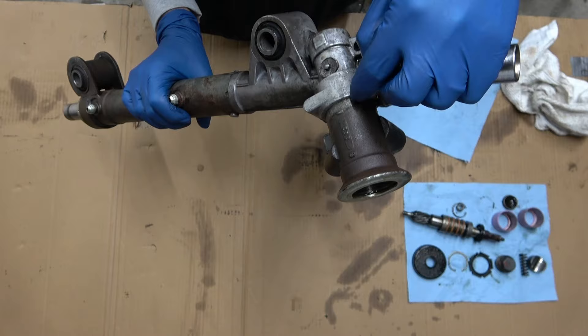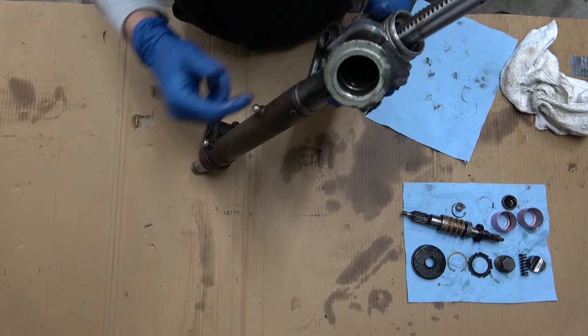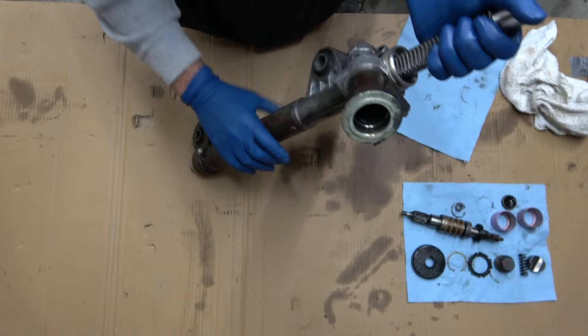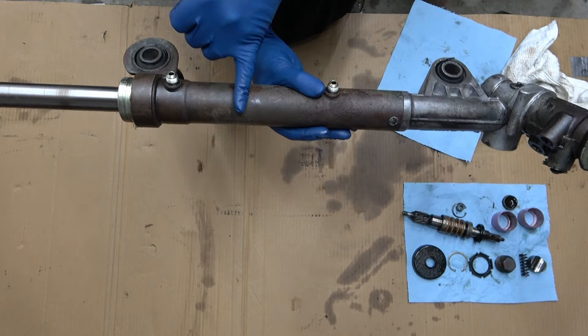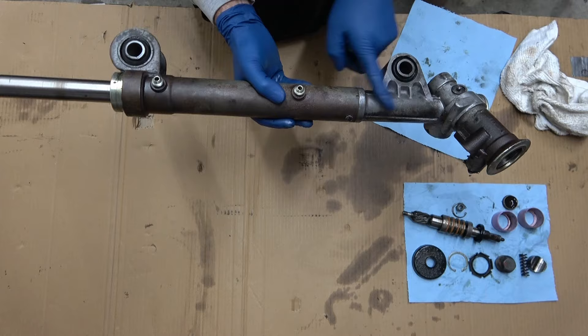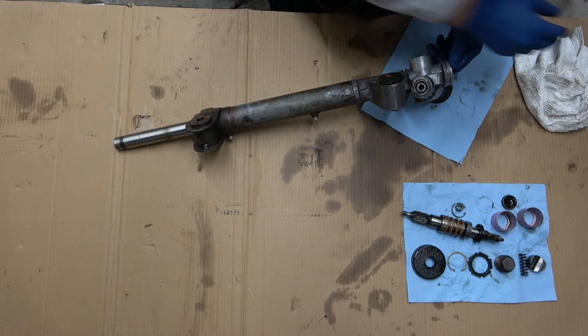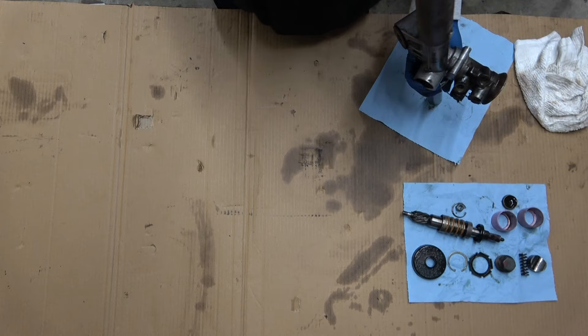With that out of the way — you're not going to be able to see it in the camera — but deep down inside here, right where the two parts of the housing meet, there's a seal that will have to get pulled out. That was leaking, allowing the fluid inside where it should just be the grease. On this side here there's a piston — well, not a piston, but another part with a seal on the rack — keeping the fluid between the ends. There's another seal down here which was probably also leaking. But with the pinion out, we can start working on getting the rack out of the whole housing itself.